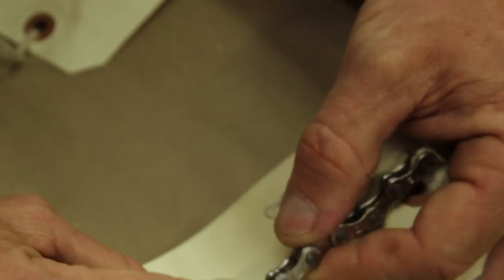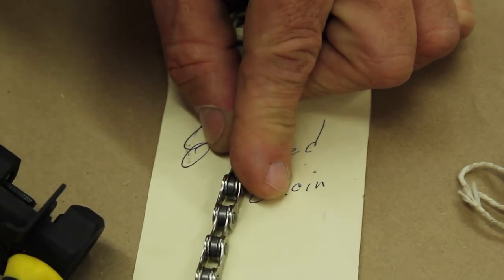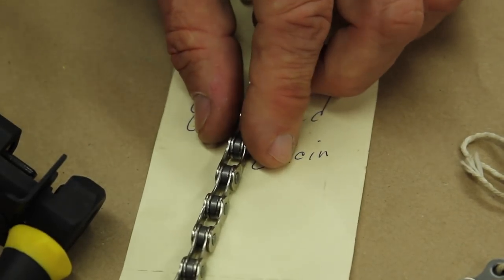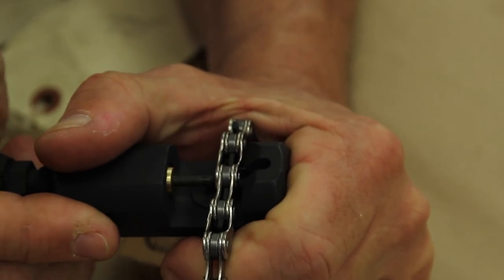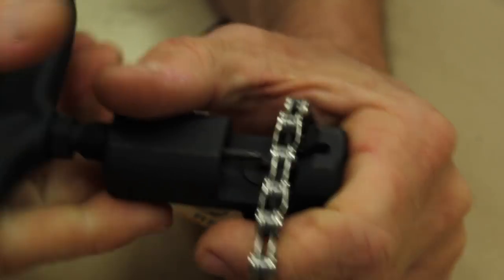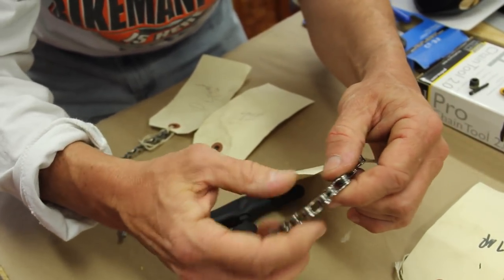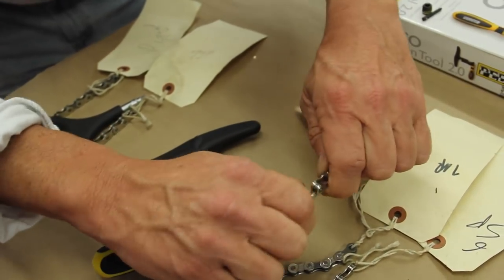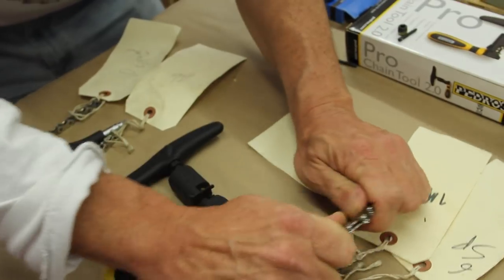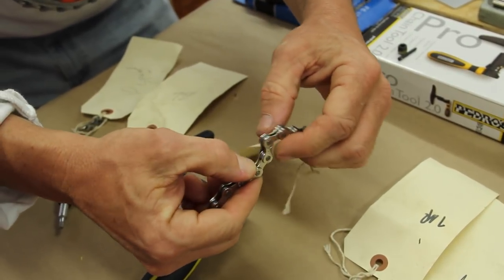You can see how she's a little too far on one side than the other. I want to push it back — literally a half of a half of a turn. Now she's really, really tight. You can see how tight it is — all the other links are nice and free but this one is very tight. In order to loosen it up, what you're going to do is go sideways with the chain — not this way, sideways — and give it a little push that way, and then a push the other way. There she is, done. See how nice and smooth it is now?